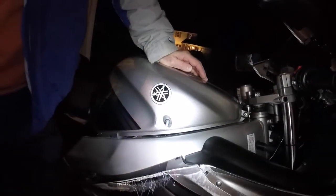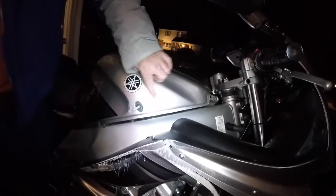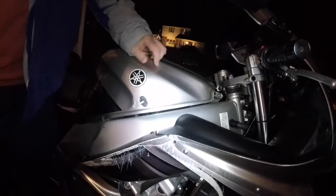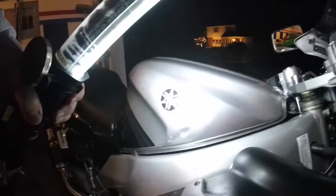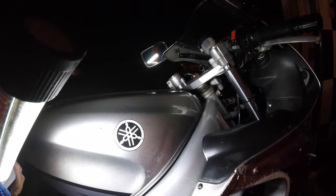We don't want to put more than an eighth of an inch of body filler on it. That's probably a 16th on that, because you only want the body filler really to be like this. So if we can get it closer, it would be better. So we've got the tank where we could definitely do body work on it now. It's not horrible now. I mean, definitely within the 16th of an inch that we can clean it up and shoot it.